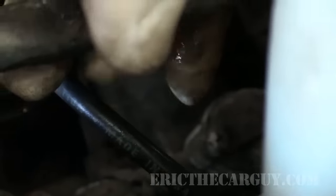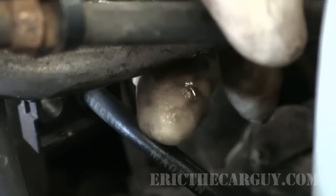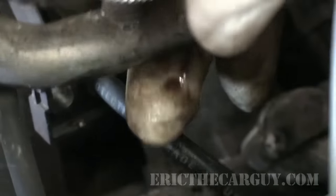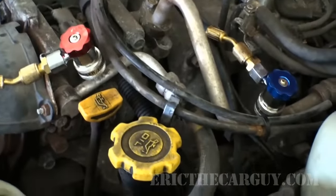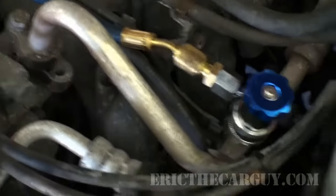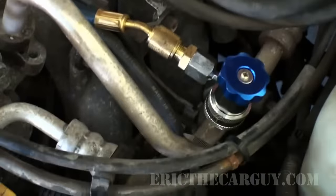There is a pretty sizable leak in this tube — in fact, there's a little puncture wound right about here. Normally I would have put a vacuum on the system to see if it would hold vacuum, and if it did not, I would know that the system is compromised. You could add AC dye — there are a few different ways to find where the leaks are — but that's the number one thing you deal with in AC: leaks. So we know there's a leak in this low pressure line.